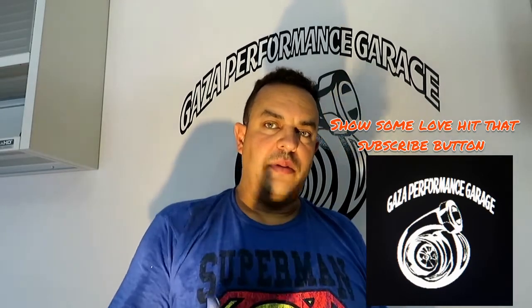Thank you for watching this video with me. We have learned today that you don't need to remove the intake manifold or fiddle with the fuel injectors, or remove a whole bunch of stuff underneath the intake manifold. All you have to do is remove the airbox, the intake plenum, and the throttle body, and you're on your way.